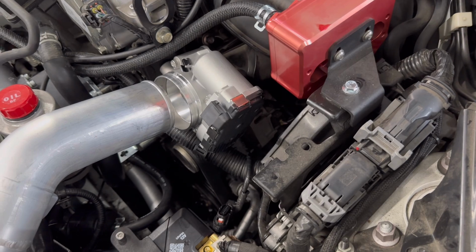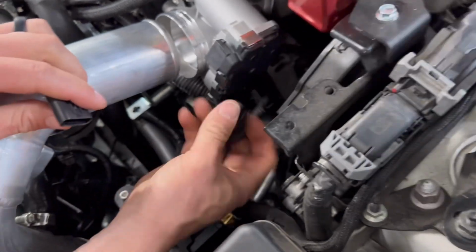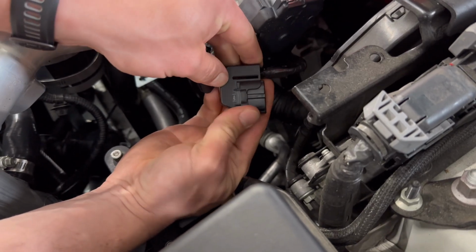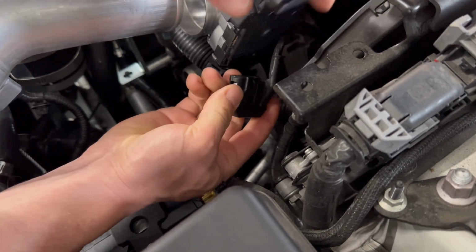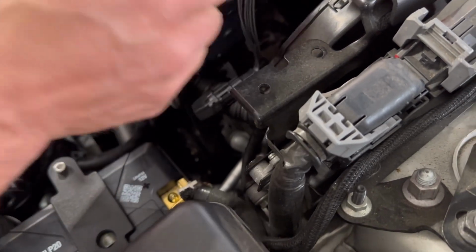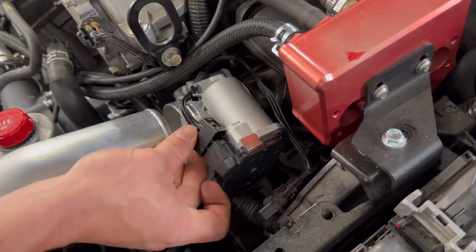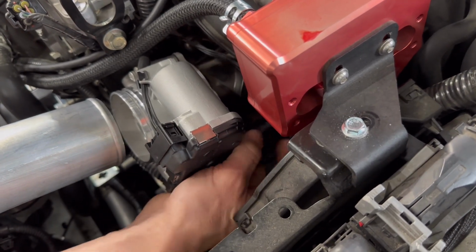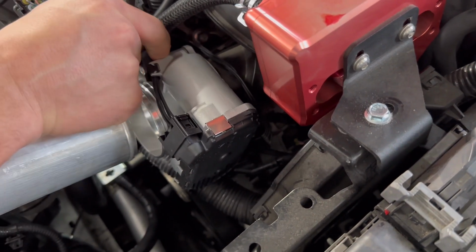I'm gonna grab the harness. We'll show you how to plug that in. Okay, so your stock harness is gonna have what's called a strain relief built into it. So there's just basically the connector housings built into this. Wires loop around. None of that really matters. It's just an explanation as to why it looks funky. Plug that in there. Harness is gonna go around the backside here, and you'll see a little harness clip. Clip it in there. This you can zip tie, you know, somewhere back here. Make sure it's not in the way of anything, but it shouldn't cause problems otherwise.